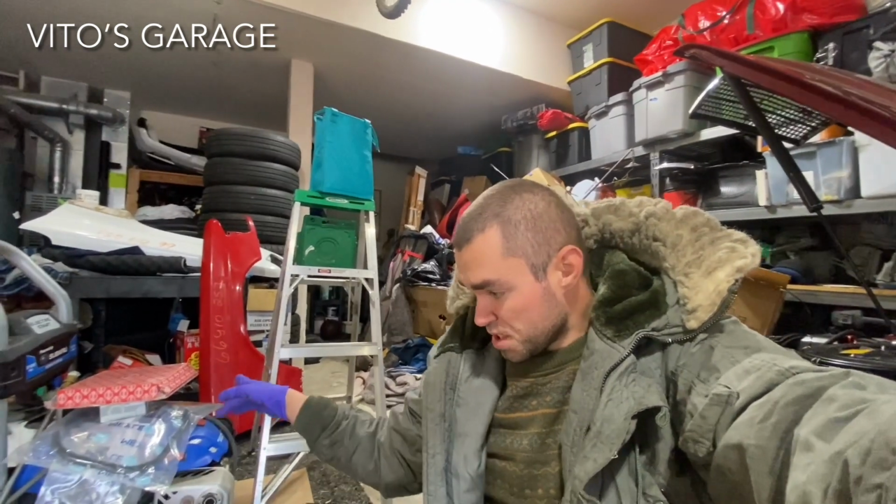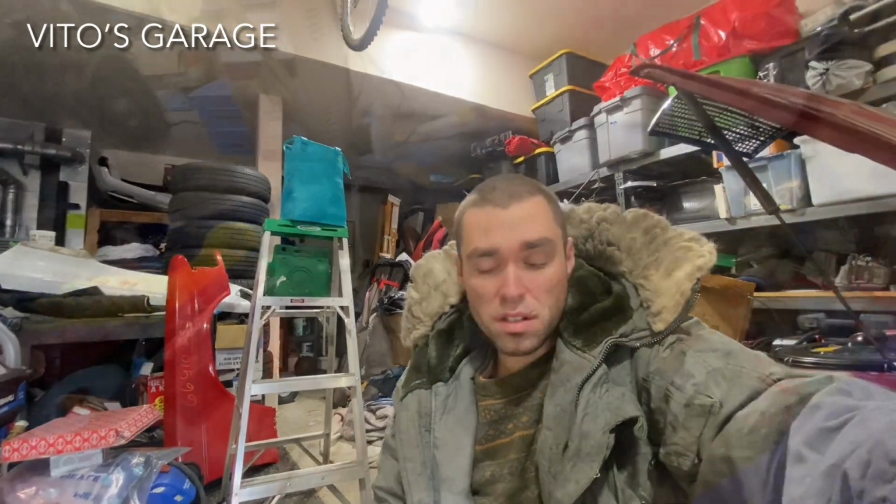Well, this is the next morning. Good morning, guys. Today we are doing a lot of stuff to the transmission. I'm gonna finish up the transmission, so I have to take out the pan, clean the pan out, change the filter, and also change the Bowden cable on it, and change the front torque converter seal. So I have all the parts there, and also have a new vacuum modulator for it that I really want to install before I install the engine transmission back into the car.